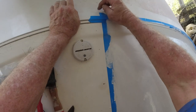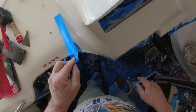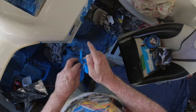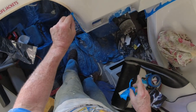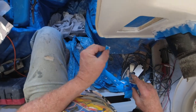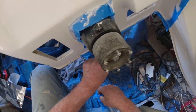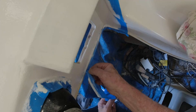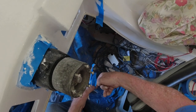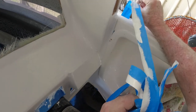For those of you that don't know: taking the masking tape off - the idea is to let the paint dry enough that it won't run when you take the masking tape off, which means it's usually got a skin on the surface. You need to peel the masking tape off and pull it at such an angle that it cuts the skin on the paint without actually pulling the paint up. If you leave it too long you either risk having the masking tape stuck there under dried paint, or pulling the paint up. It's a little bit different with flow coat or gel coat because that dries really hard and will trap your masking tape if you don't get the timing right.